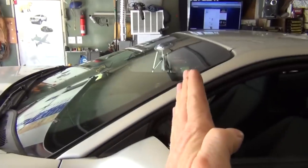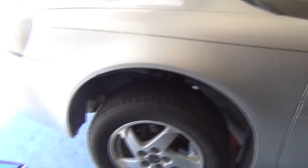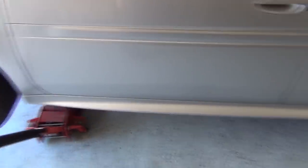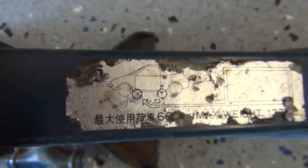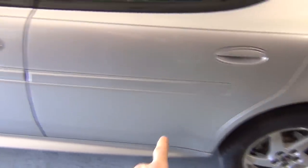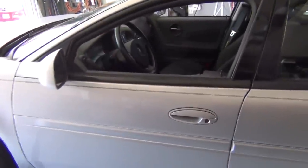Say I want to lift up the front - then I need to be forward of where that mirror is. So in this case where I wanted to do a video on the front of the car, I just picked a spot like right here. Those same points that we saw on the jack are where most vehicle hoists will lift a vehicle - they just have pads that go right into those spots. If you want to lift the back of the vehicle, all you've got to do is be behind that fulcrum point, that balancing point that the car has.